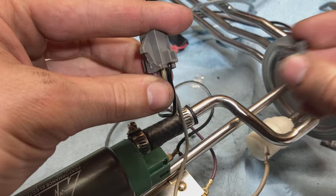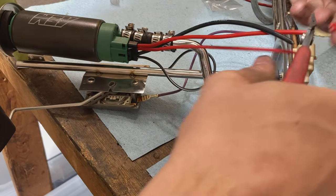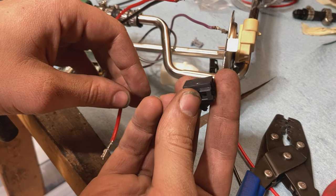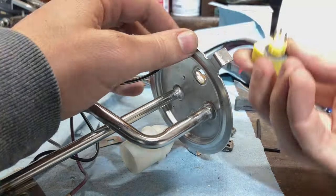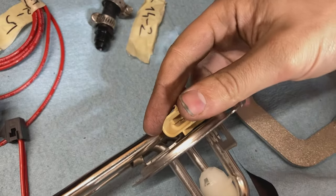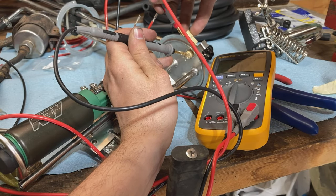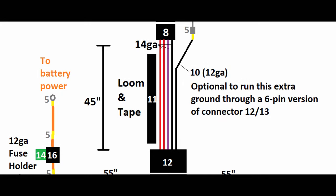You could reuse this four pin connector and just put an extra pin in there. Pull out the tab on the back and then stick a hair pin into the slot on the front of the connector. Strip these to length and then crimp the new pins on that go to this bulkhead connector. For these smaller pins I'm using the D crimp for the wire and the C crimp for the insulation. Let's get this three pin bulkhead connector removed — I'm going to have to pry up on some of these tabs in order to release it. Now put the new four pin Racetronix bulkhead connector on. It's a press fit with the bottom bracket. In order to press this latch on I'm using an 11mm socket and putting a little key behind the connector on my vise. Press the socket on — there should not be any play in the bulkhead at all when you're done. Now I'm going to pin out the connector on the bulkhead to see where the pins go.